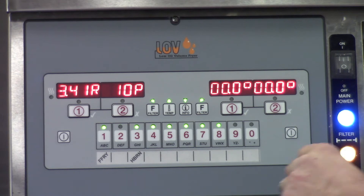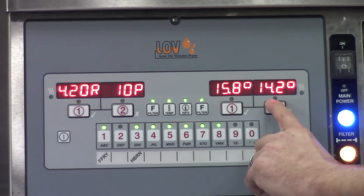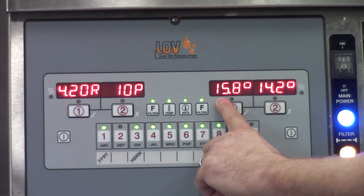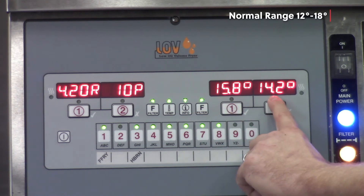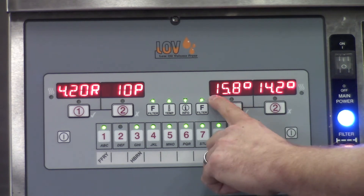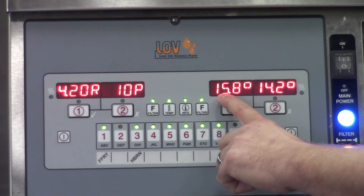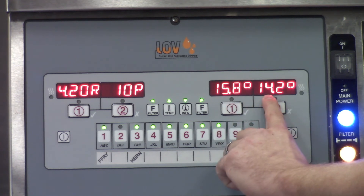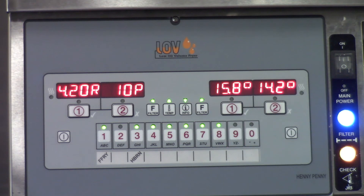The main numbers we are looking for here are our position switch and our home switch — we want to know what that activity is. We need to make sure that the position switch is between 12 and 18 and the home switch is also between 12 and 18. If we are seeing a zero on either one of these switches, or maybe even a zero on both of them, this would indicate a faulty switch assembly and we would need to look at replacing that selector switch assembly. Be sure to check out the selector switch assembly video for more details. If either number is outside the 12 to 18 range, we would need to go in and do a selector switch adjustment process.